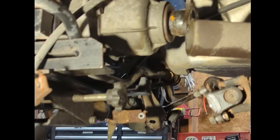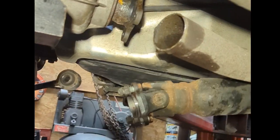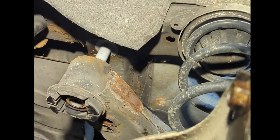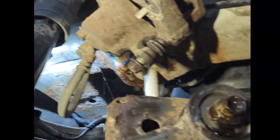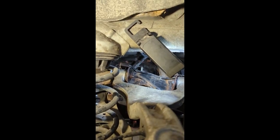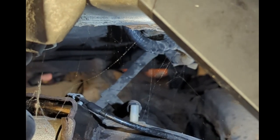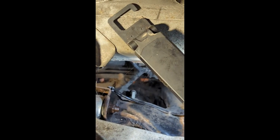I'm at the point where I have the exhaust cut, drive shafts hung, and all four of these connection points off. As you can see, there's a gap — I already started dropping this down. The only other thing I'm noticing is back in there, there is a wire harness running on a 45-degree angle coming down. I've got to go back up a couple inches and get that disconnected, but it looks like maybe just that one wire harness and we should be good to go.